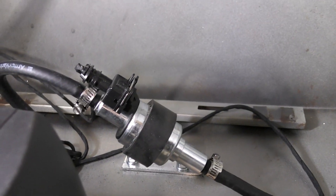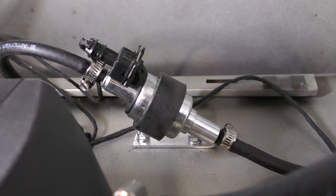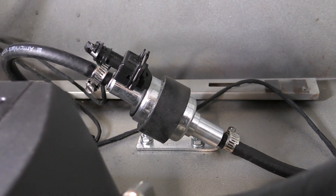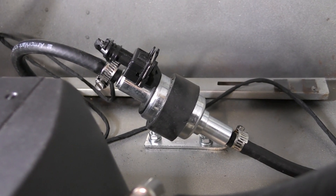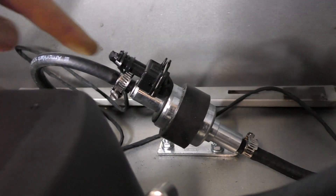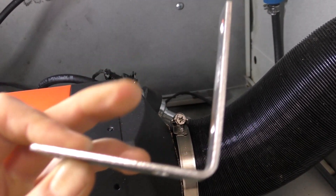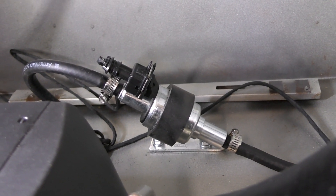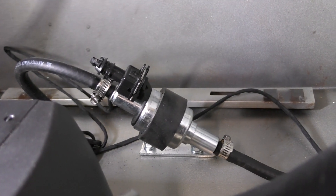The third suggestion — actually a correction — was that my fuel pump was just bracketed horizontally onto the bottom of the case and didn't have the angle or lift it should have. That's not called out in the instructions, but if you read online, these should have some kind of angle or lift on the output side of the pump. What I did was take a 3-inch angle bracket from my hardware stash, bent it to about a 30-degree angle, and mounted the pump to that. You should absolutely have an upward slope on the output side of your fuel pump, as the manufacturer suggests.